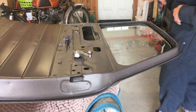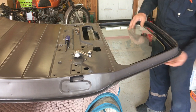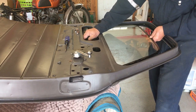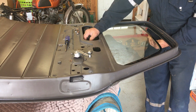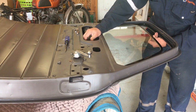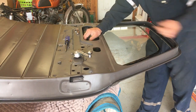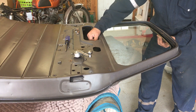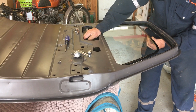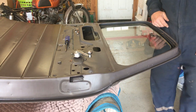The window's in but not connected to the regulator. It moves a little better and I don't hear that metal on metal noise because the screws are out, but it definitely hangs up. For anybody who thinks I don't read the comments — Joe Sousa said to try some dishwashing liquid as a lube. I'm thinking some kind of lube on the tracks might make a difference. I'm not sure about dishwashing liquid because once it dries won't it just stop lubricating, but I'll give it a shot — what do I got to lose? I'll get some from the kitchen right now.